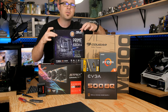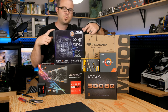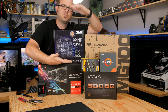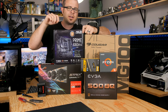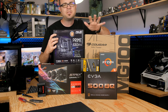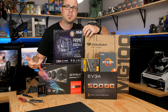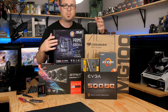The second piece you're going to need is a motherboard — the central piece that holds everything together. The motherboard we're using is the Asus Prime B350-M-A. It's a micro-ATX motherboard, which means it's a little bit smaller than a full-size ATX board. B350 is a more inexpensive chipset for Ryzen processors. If you go up to the X370, the main thing you get is support for two-way graphics cards — SLI and Crossfire — which isn't a big deal for most people building on a budget.